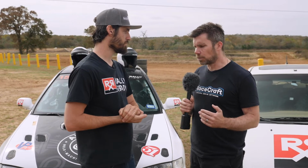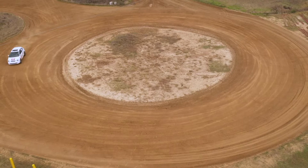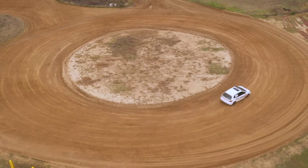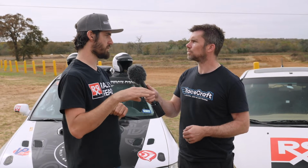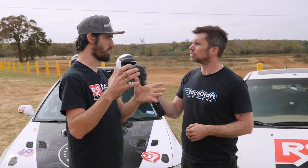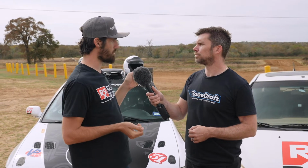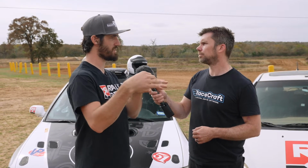All right, so for those watching at home, how much pressure are we applying, and when we apply that pressure, what happens? Is this where we find that the nose of the car will tuck into the corner? Yeah, so there's a whole lot of things happening with left foot braking. In an open diff car like this, you're sort of using it as a false limited slip since you're dragging brakes on all four corners. You're preventing some of that wheel spin. You're also sort of dragging the rear brakes, which allows the back to slide, and you're moving weight forward, which also helps that turn in.